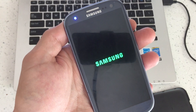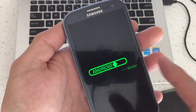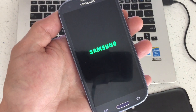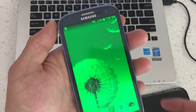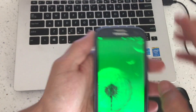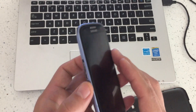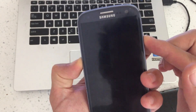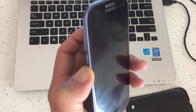I'm going to show you the third way to get into safe mode. Hopefully the restart gets us out of safe mode. There are times you guys can't get out of safe mode — just comment below and I'll help, because there are special keys you need to use. For the third way, we're going to power down the phone — I'll just pull the battery and put it back in. Now I'm going to hold down the volume down button, then hold the power button down as well. Once I feel it vibrate, I let go of the power button and continue to hold the volume down button.